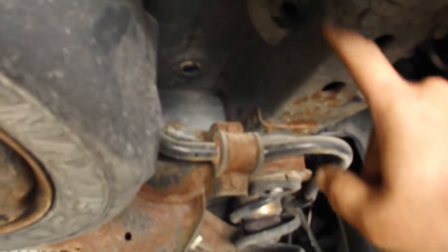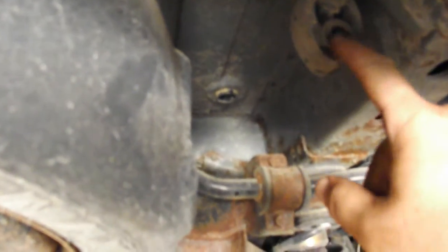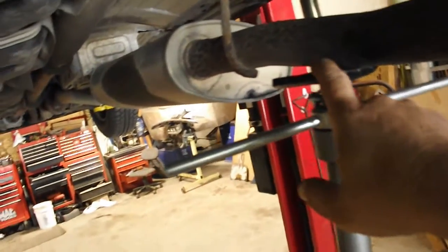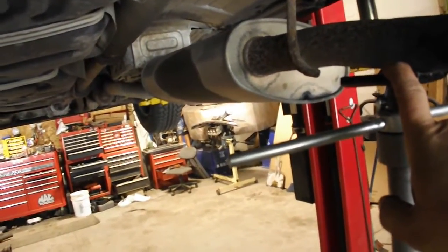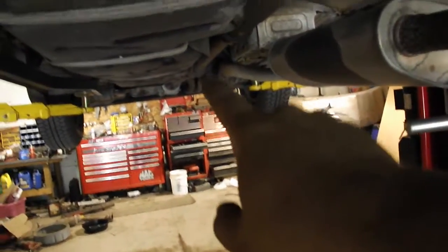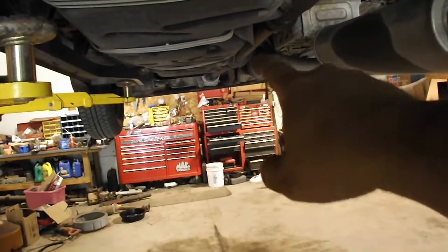All I did was drop it down. I sprayed a little bit of penetrating oil or lubricant of your choice into each one of these hangers and popped them off. You can use a pry bar — I just used my work gloves. There's one more right there on top of the muffler. Make sure you support the muffler with something because there's nothing else supporting it from this point forward, and you don't want to put that much tension on the flex pipe in front of the catalytic converter because you will break that. So let's go ahead and get the hitch up in here.